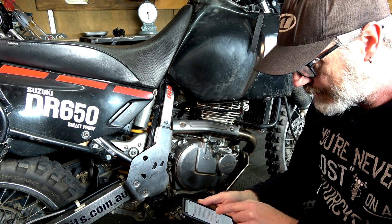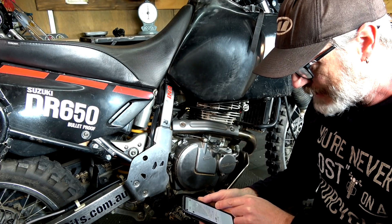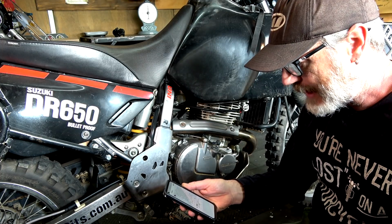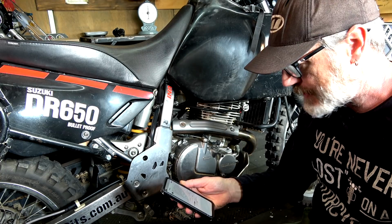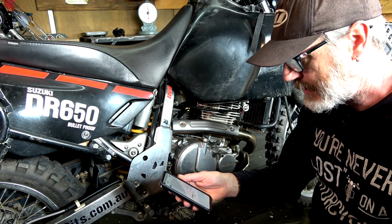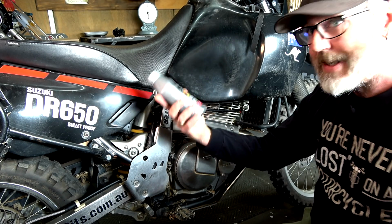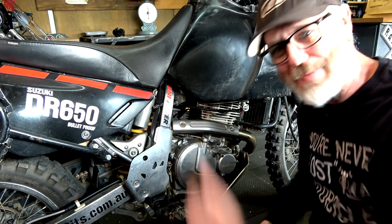"Only difference between DOT 4 and DOT 4 plus is the wet boiling point being 165 centigrade for regular and 180 centigrade for the plus. But both have the same viscosity, definitely a worthwhile upgrade in your hot climate. Great video." Brilliant, thanks Seb, man, that's awesome. So there you go. Now I know the difference between the two, and here in Australia, it's good to have the extra one. Righto, back up here.